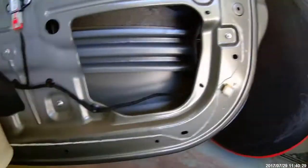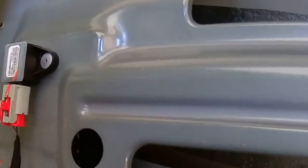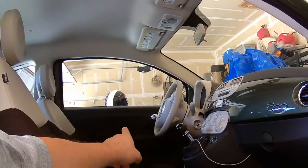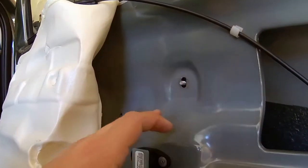Here's what I've got — it's been peeled back. I'm just going to wrap it around and use its own sticky stuff to hold it out of the way while I do my work. Right off the bat I found that a bolt had come loose. I experienced this similar rattling on the other side, and when I got body work done after getting hit, the rattle was gone. I think what happened is they put the bolt back on. So that may be all I need to do to fix this rattle.